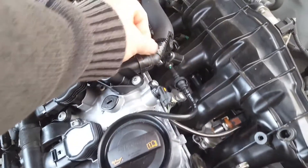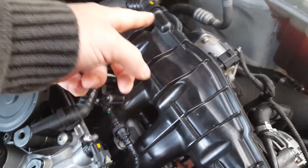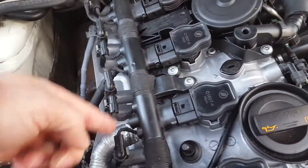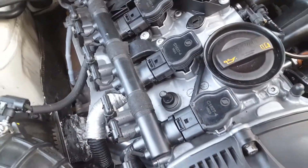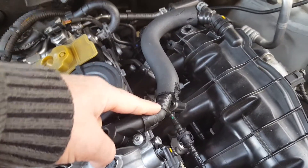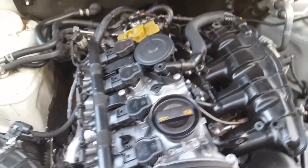In some cases you'll see people remove the breather hose and cap both ends off. Capping the turbo-side off is okay because it will still pull from the turbo — that's not a problem. But capping the crankcase-side breather hose off is a bad idea. The crankcase needs to breathe; the pressure has to go somewhere. When the turbo boosts, it basically vacuums the air out of the crankcase, around into the intake, and burns whatever comes through. I would never remove this hose and block it — this hose is here for a reason and needs to stay.